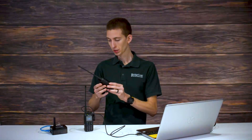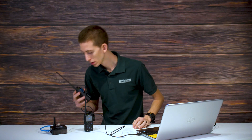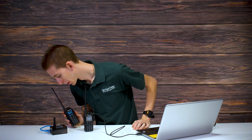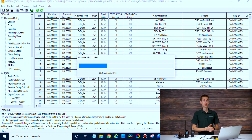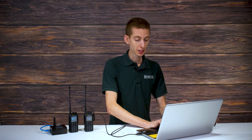Let's try it out with this radio — got it set up on the parrot here, we'll see if it works. Now our SkyBridge — it looks like we're on 446.525, so you always want to make sure the frequency that your SkyBridge is on matches the radio. If you buy an UltraCode plug and a SkyBridge, they're automatically going to match — we actually take care of that for you. I've just been playing around with this the other day and it's on a different frequency, so we want to make sure that matches.